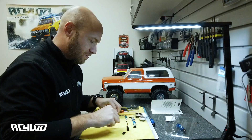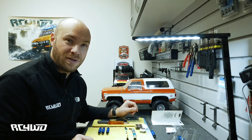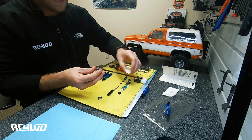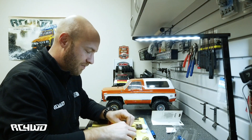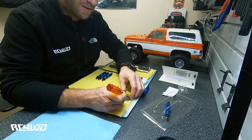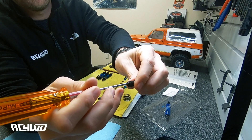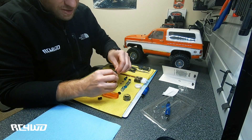Now I'm going to go over how to build the shock. I know there are a lot of videos out there on how to do it, but we'll run through it so you can see how it works specifically with these shocks. The first thing we want to do is get some grease and grease up the x-rings before we put them back in the shock. We're going to grease up everything that goes inside the cartridge. I like to use the end of my wrench to do that — just put a little grease down inside the body.